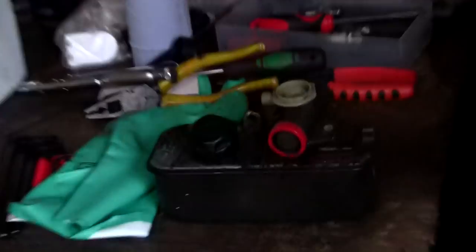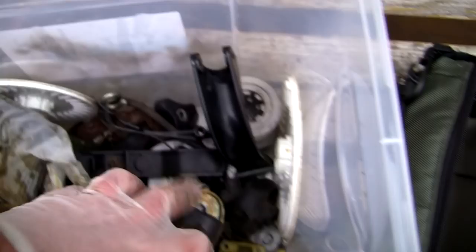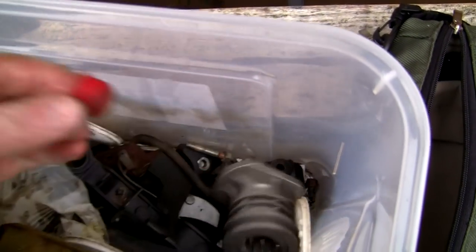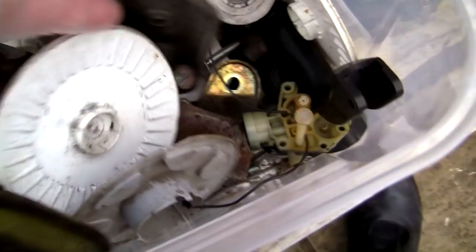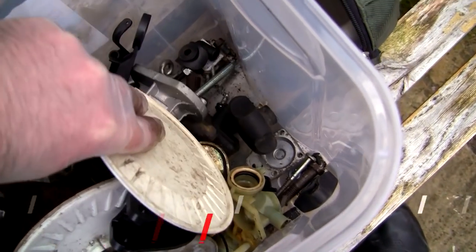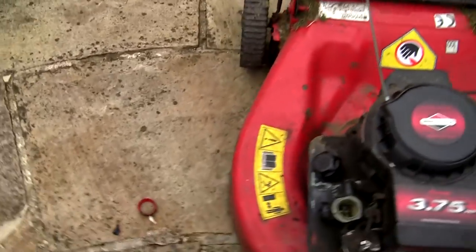It's a while since I've been in here. I do have a spare carburetor somewhere — but that's one I use just for testing lawnmowers when I get them in. I like to just bolt that on because I know that one works well. The question is whether I have a primer bulb. I've got a bulb there — let me see if there are any splits in it. There's one there. Let's change the primer bulb over and see if we can start this lawnmower in the normal way just by pressing the primer bulb. If I can get this swapped over we can have a lawnmower that will start and run properly.